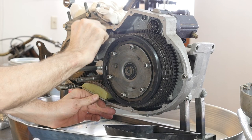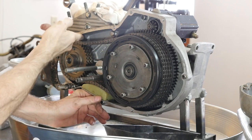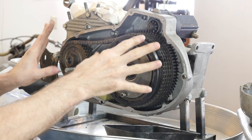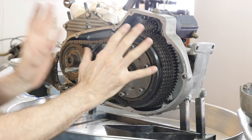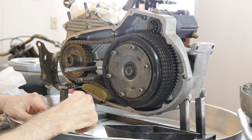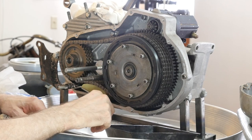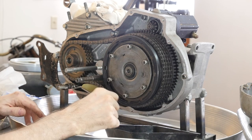What I used to do is have it so loose that it would grind here. So I'd kind of feel it and say, well, I want it pretty loose. The tricky thing is, all this stuff is so sloppily made that as you turn it, it'll be tight and loose because the sprockets aren't machined perfectly centered. Here's the shifter shaft — maybe no springs in here. That's why I could turn that and this part wasn't turning. But I'm glad to see the parts are here.